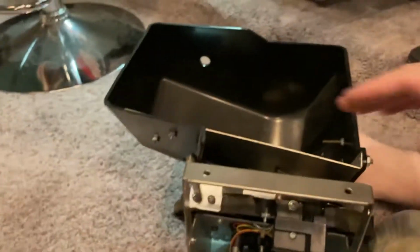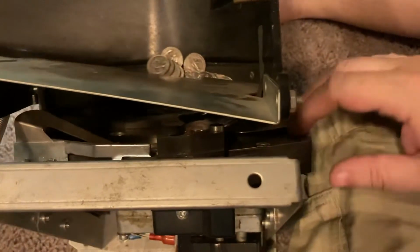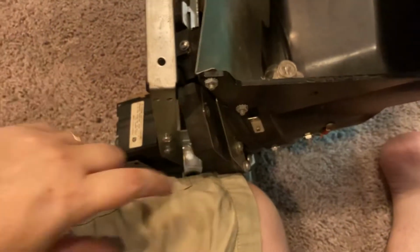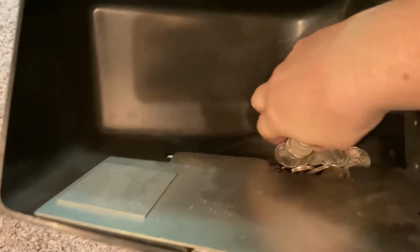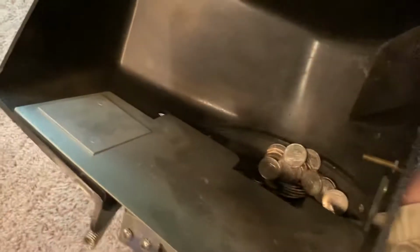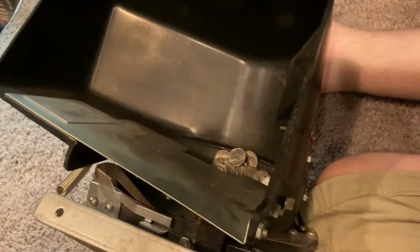The way the hopper works, by the way, is that, of course, the coins go in here, and then there's this little wheel that turns, and the coins kind of line up, and they just kind of turn inside of the wheel. Probably making you guys dizzy, I apologize. And then they basically come spitting out here and into the tray. So if it gets gunked up or there's too much space in between the bucket and the wheel, then the coins get lodged and you have to basically shake it to get it loose. Or I'd put the finger in like this. And boy, you can see why casinos didn't like this stuff. It's a lot of work.